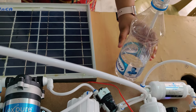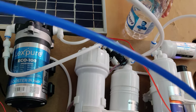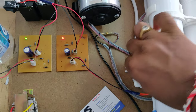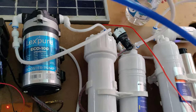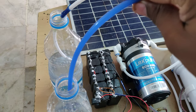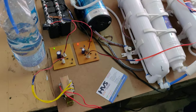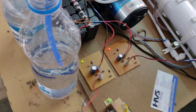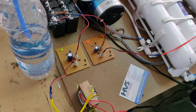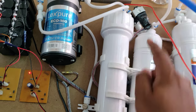You can see this is the purified water along with minerals added. If you want higher purification, just tighten this valve — when you tighten it, the water flow will decrease here and the rejection water will increase. This acts as a TDS controller to achieve more water purification. The system will do more recycling, resulting in more rejection water and less purified water. This is the main control purpose, and the solenoid valve controls the water flow.